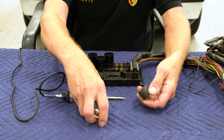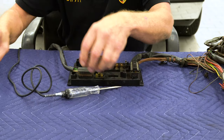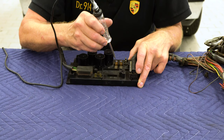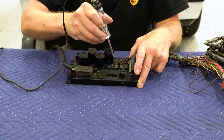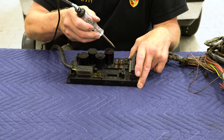I have the red 16-amp fuses, the blue 25-amp fuses, and the white 8-amp fuses — not just for the relay board but in general for the car. First thing I do is ground my test light and touch it to the positive terminal of the battery to make sure my test light works. Then I go to the terminal — not the fuse, because the fuse may not be making connection — I go to this terminal to make sure the test light lights. This is where the power comes in, and then I go to the other side of the terminal to make sure the power is actually flowing through the fuse. If you have power on one side and not the other, the fuse is either bad or not making connection. You need to make sure the fuse is both good and making connection.